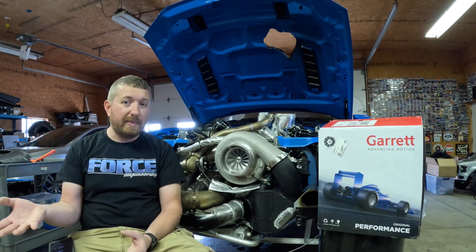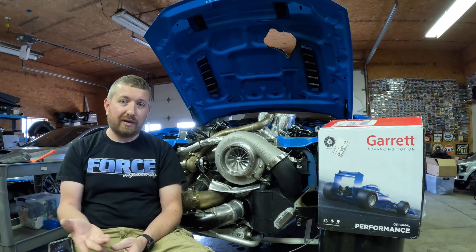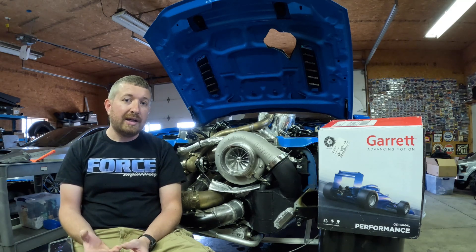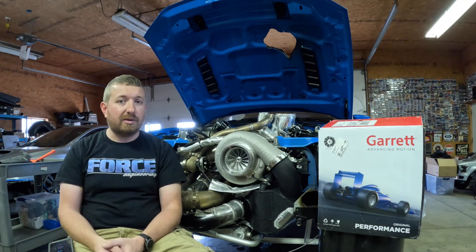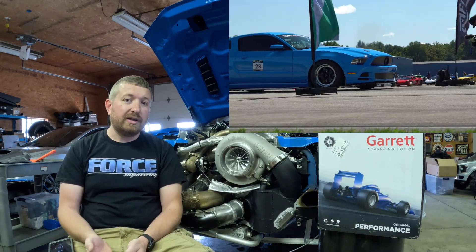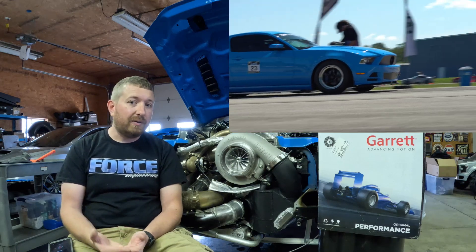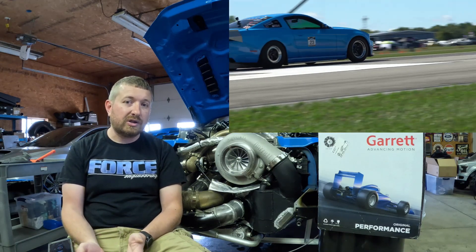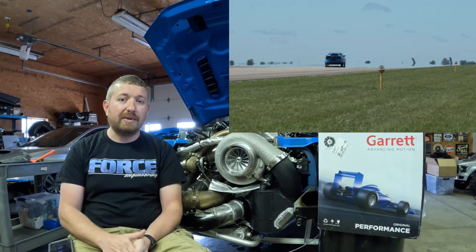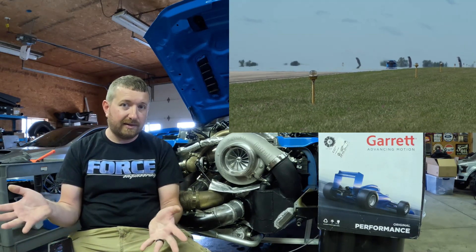The engine's job is really to move enough air to get the turbocharger to stay in a happy operating range and not blow up — that's really its two main criteria. So if we've got enough turbocharger to support the horsepower, thus the 3,000 goal, you get a turbocharger that supports 3,000 horsepower. Even if you think it's going to be hard to get the thing to spool how you want, you can fix that later. All you need to spool a laggy turbocharger: turn the engine more RPM, spray it with some nitrous, work on some launch control, anti-lag strategies. That's going to put more exhaust energy into it at a lower RPM to get it on the transbrake. This is normal stuff — it's not new.